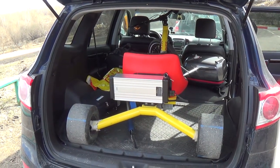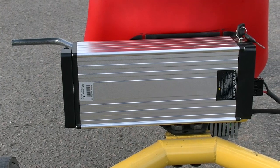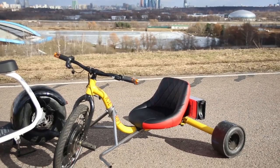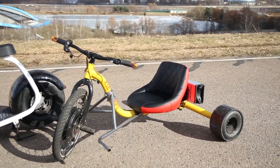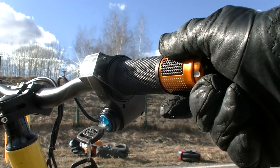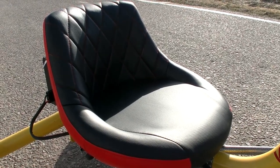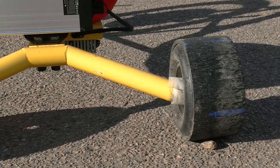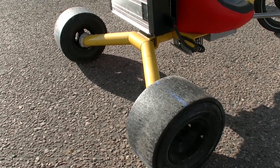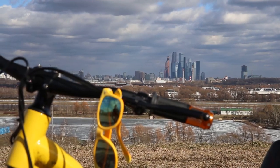So if the battery is low, it would be rather tough to move it manually. There is a 20 Ah battery which should provide about 40 km of smooth riding, but in fact it provides about 20 to 30 km. The battery can be dismantled to be charged, and a full charge will take about 5 hours. There is a nice throttle handle and a display where you can see battery status. The armchair is rather comfortable and nice looking. Rear wheels are covered with special shields to provide sliding and drifting. As already mentioned, we have a front wheel drive, and many drift fans may say that is completely wrong for a drift trike - I would rather agree with them. But anyway, let's try to do some drift.